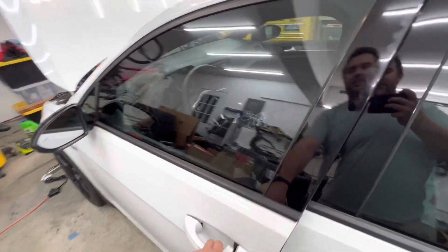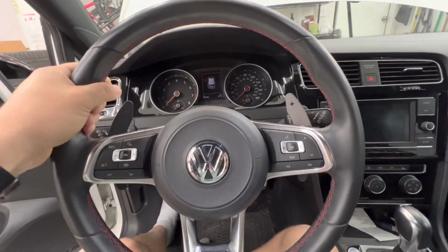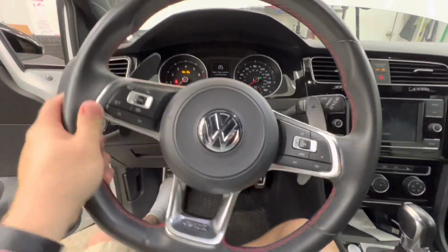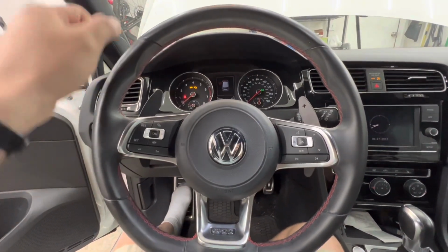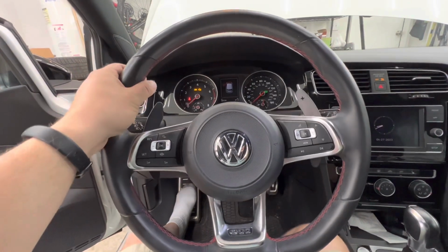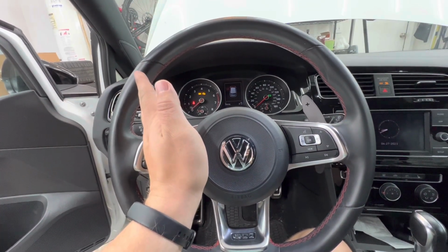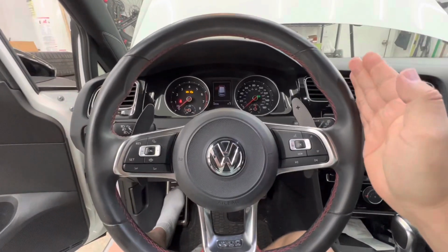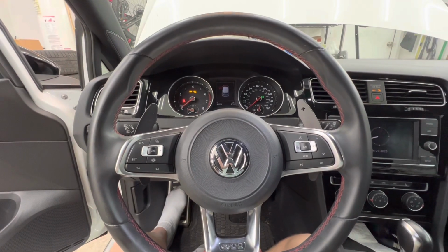But essentially all that I do, the normal process, would be you get inside the car and I basically just visualize, all right, was the steering wheel left off center or right off center while you're driving in a straight line. If you're driving in a straight line down the road and the wheel is slightly to the right, what I do is I visualize, I come back in here and I straighten the wheel. When you straighten the wheel, both of the tires turn left. The steering tie rods are behind the axle, so that means on the left side of the car, you have to lengthen that tie rod, and on the right side of the car, you have to shorten it in order to straighten the wheels in relation to the steering wheel.